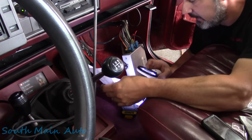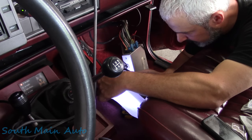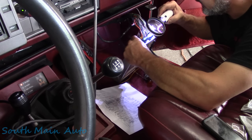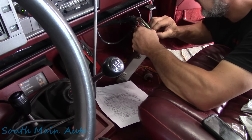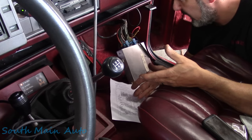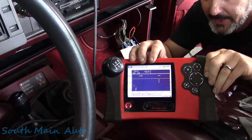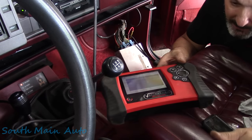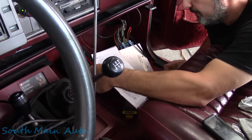And then let's just check one other thing here, because there's really not much sense of checking anything else. Our purple wire, let's just see where that goes. Sensor return is in the other connector, A11, and it's purple. A11, that's right next to the ground that we're plugged into. We're gonna plug into the actual sensor ground and make sure that it's nice and steady. Typically, if you would have lost the sensor ground or a sensor return, as they call it on this, your voltage would go high, it wouldn't go low. So right now we're plugged into the map sensor ground wire and the signal wire, and key on engine off, we're at 4.63, which would be barometric pressure, which is good. Although on scan data, it's going stupid.